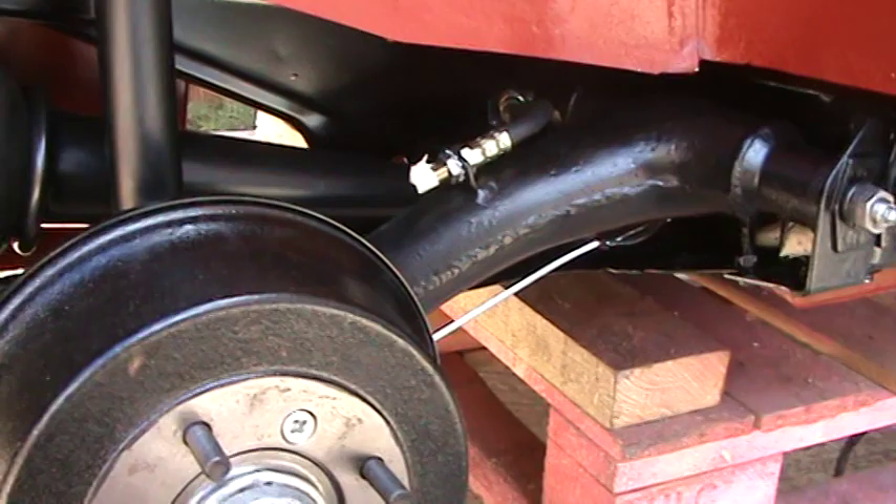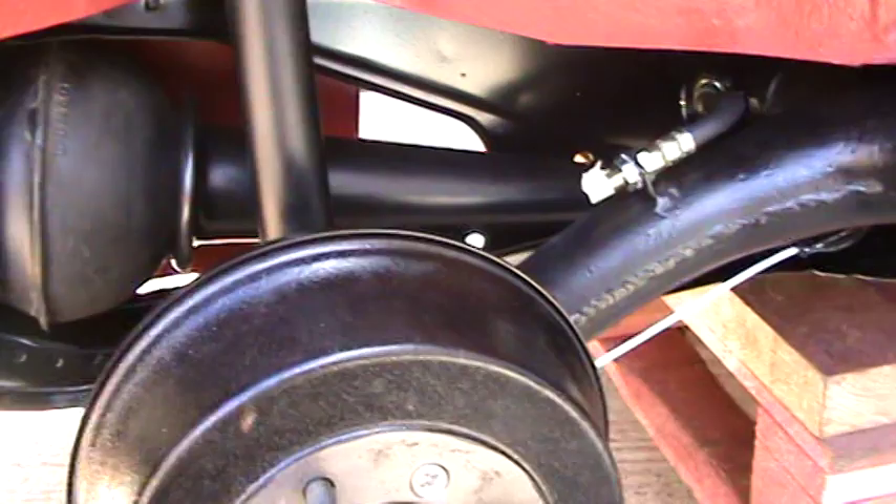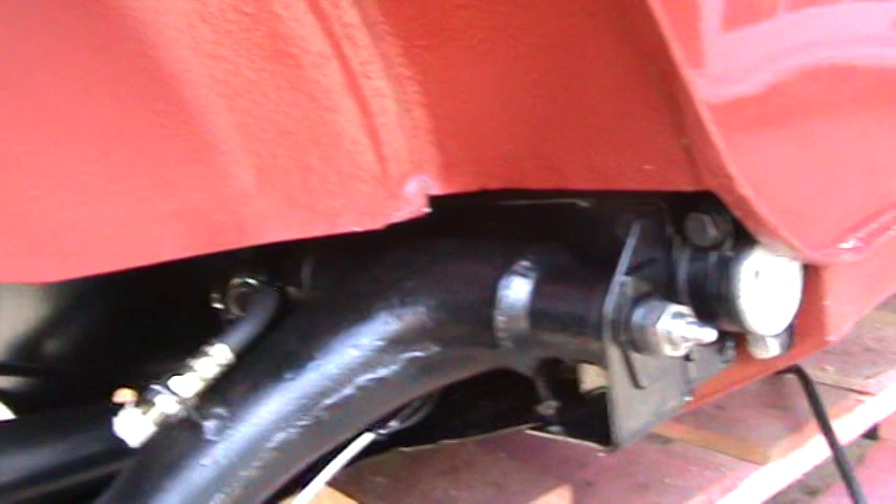There are new wheel bearings and also original suspension struts — trumpets — and new suspension rubber cones, so all of that is new as well. I've tried to keep the running gear as original as possible, but obviously things like the subframe do corrode on Minis, so I've had to replace that one unfortunately.